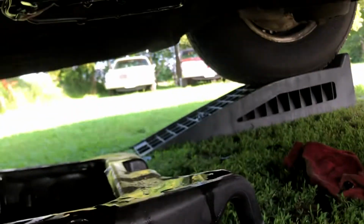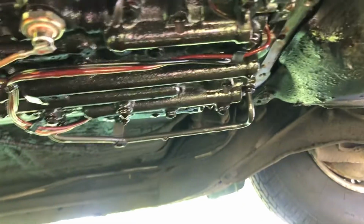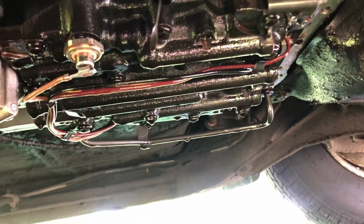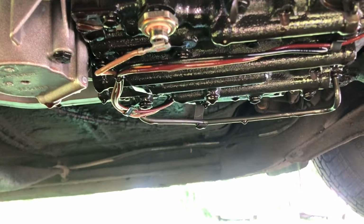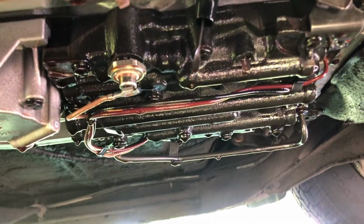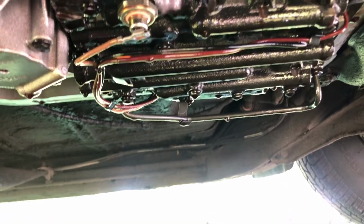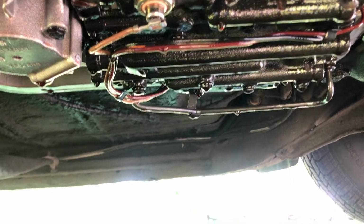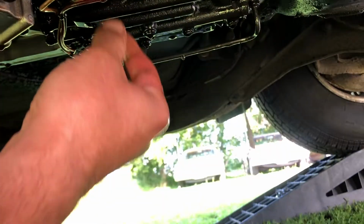So anyway, I'm just trying to see if I can get the torque lockup to work, because this engine is a 403 engine, and it burns enough fuel all on its own, right? Without the lockup, it's just burning fuel for no reason. And this transmission does have the torque lockup, so I'd like to get it working. So I ordered a new one. I have it. It's a standard Motor Products lockup solenoid. So I'm going to try and see if I can get this humming.